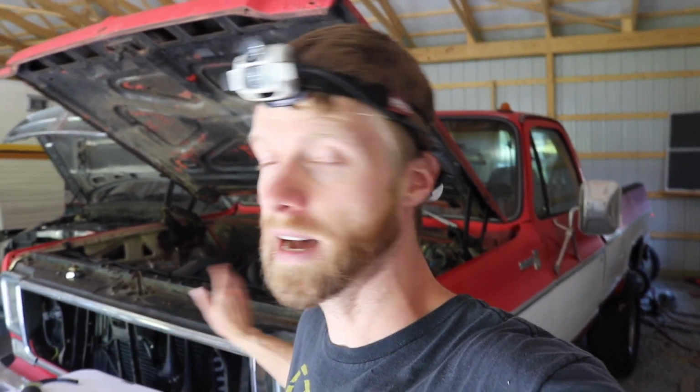I doubt that this is gonna fix the problem, because it really didn't do anything. I took the radiator out. I did flush it with the garden hose, and some rust and calcium deposits came out, but it wasn't bad. I mean, it flowed. So we're gonna run it and see if it fixes the problem of it still overheating. We're gonna try and keep these coolant temps below the 235 that it hit. It's not uncommon for this thing, when I'm hauling the camper over some hills, to hit 220. I'm okay with 220 on these recent trips, which is not good. This thing should not be overheating like that. I hit 235 Fahrenheit coolant temp. If it hit 240, I was pulling over. I didn't, but I had to pull over on some of the mountain passes that I was going over in Maine. So there's an issue.